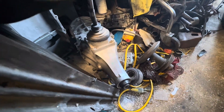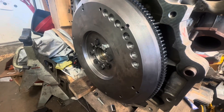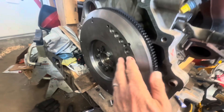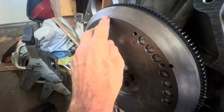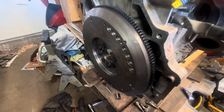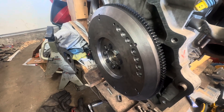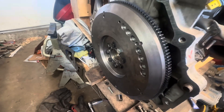I could even put my transmission on there — I've got an AR-5 sitting in there. Go all the way with it. Got everything re-drilled. Got it all torqued down to 65 pounds. Hopefully that's what it's supposed to be. Blue Loctite. So let's settle this pressure plate and disc.